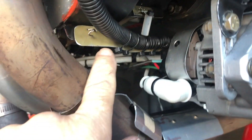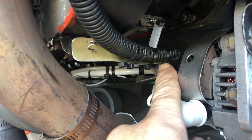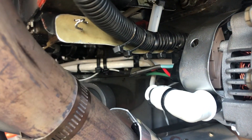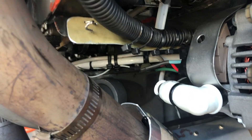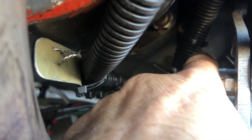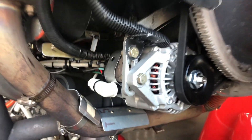I also added another blast tube here. I took the longer one that was here and moved it to the back, making a little attachment piece off this baffling, so I've got it blowing right on the back. With the other one blowing at the bottom, I've got air moving all the way across the back of the alternator. Now I know I'm going to catch some flack for putting zip ties right here — and this is the hottest part of the engine — so I'm going to keep an eye on that. When I do my next annual in a few months, I'll probably come up with something more professional and permanent. Right now it'll get air flowing from two places on the back, covering the stator and rotor area — hopefully that'll help keep it cool.